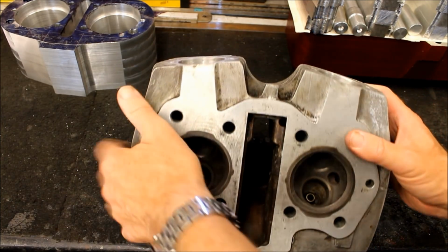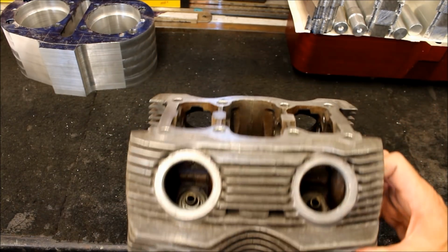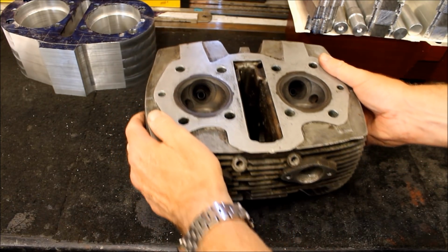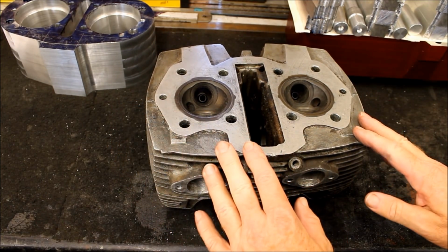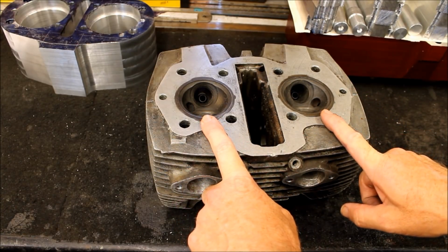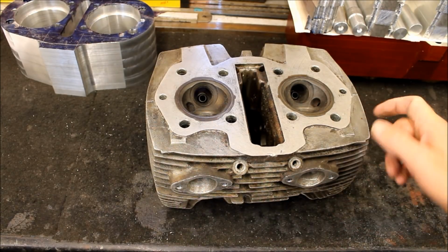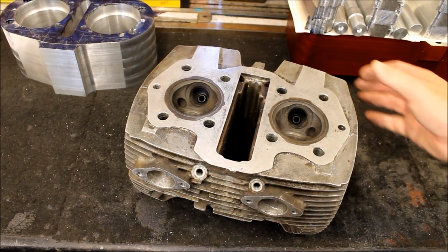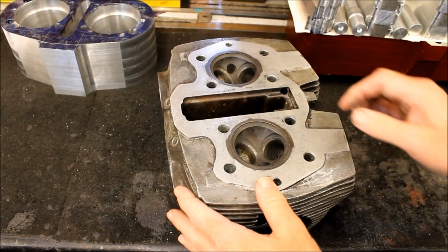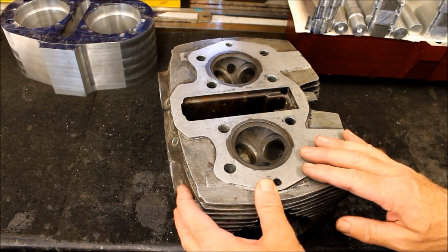Sorry. I'm not sure what the difference is between the bore, the sleeve in them is opened out a little bit more than 72. And you were saying then, the reason why you like this head is, well, I like the engines. Well, the engine in general, but it's quite nice to have these heads, they were probably cast steel. And obviously with nitromethane, it helps to strengthen the head, plus these basically got an insert in them here, haven't they? They're actually cast in with it.